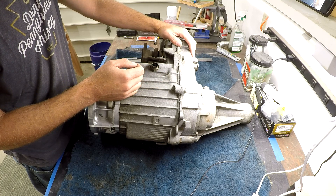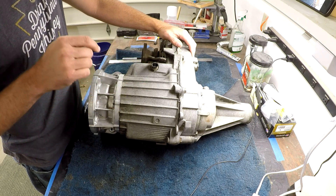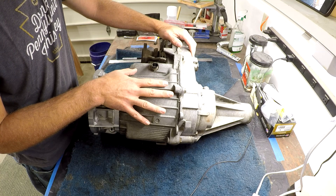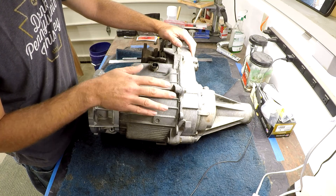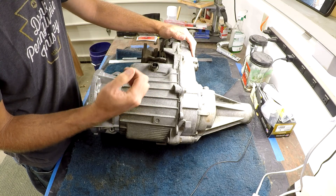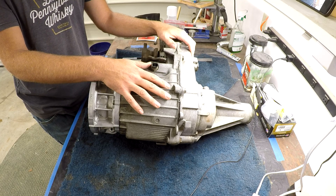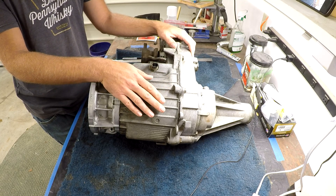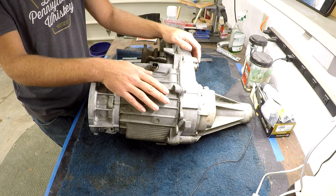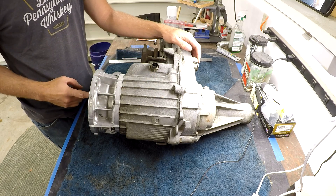The number that seems acceptable to avoid case hardening and strength issues is 32 spline. The stock NP208 that came in my Suburban does not have a 32-spline input — behind the 700R4 I believe it's a 29-spline input. You shouldn't go down to 29 splines on the 6L90E. What I have here is an NP208C I found at a junkyard in very good shape — it was behind a Turbo Hydramatic 400, and if you find one behind a TH400, it's already got a 32-spline input shaft.